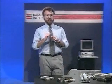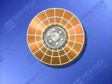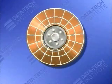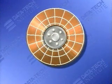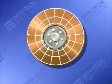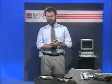By the way, the first cylinder is numbered not 1, but 0. Computer people often do that, counting from 0. Ask a techie to count his fingers, and he'll count 0, 1, 2, 3, 4. The tracks are then cut up like wedges of pie into sectors. Most drives divide a track into 17 sectors, although some others, as I'll explain later, attempt to squeeze more data on the disk by putting more sectors on each track. Finally, each sector contains 512 bytes.